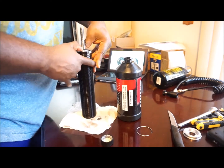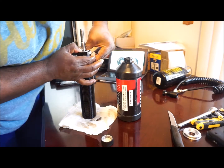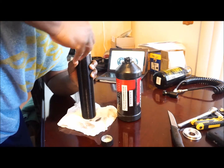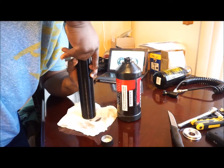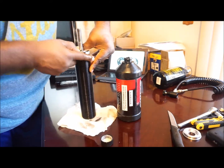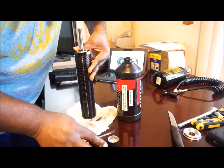There we go — now I can get it down. I had too much fluid in there considering the position of the piston, the shock valve. So now I'm pushing the C-ring down, trying to get it into its channel in the shock body. There we go.